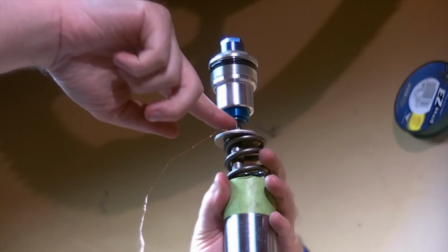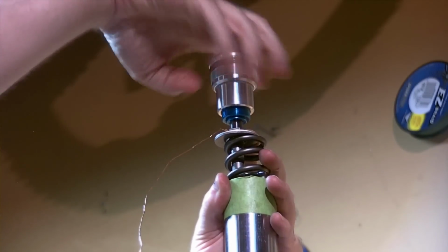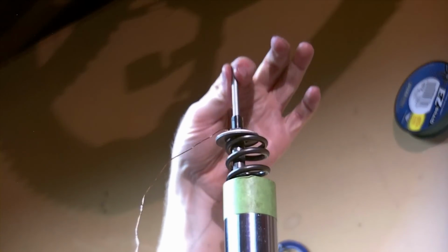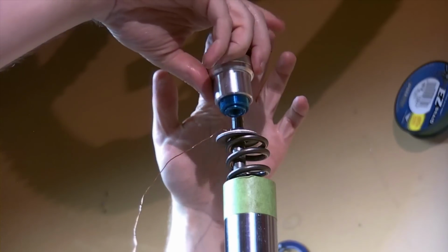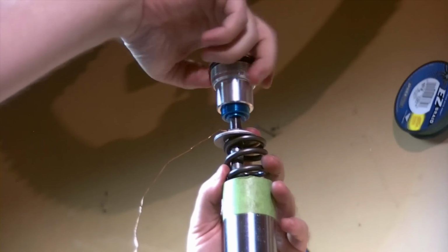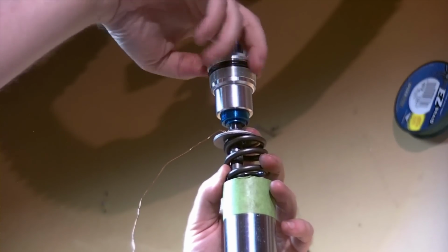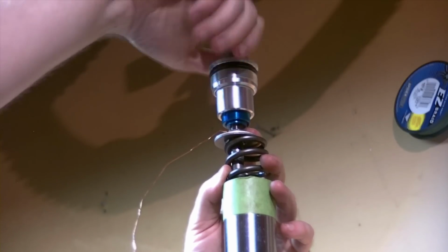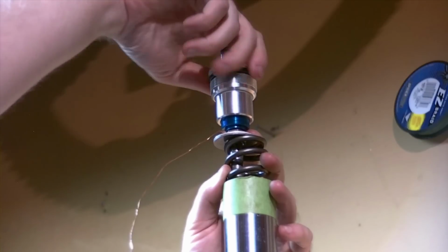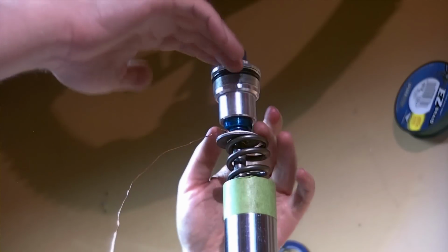If you were to manipulate this thread height, you would change the inner rod. If you recall, I'll show you here, this inner rod here, you would effectively change how close it is to that adjuster, being able to do this and that. So that's why you have a specification for where that needs to go. Again, it's important to keep them even between them. So I'm just going to snug this down. Finger tightened those together until they're just touching.